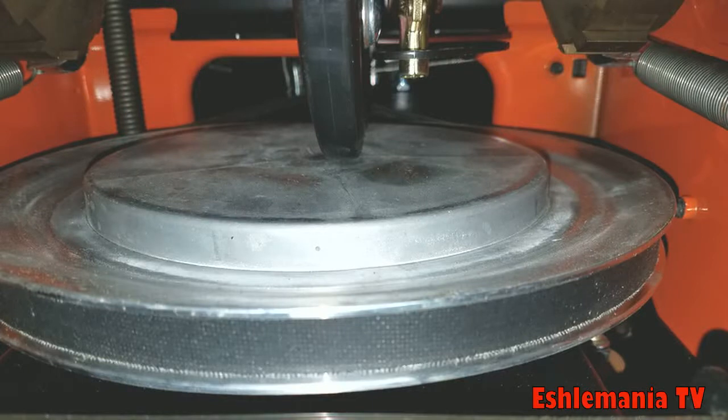This is a look inside the drive housing on the snowblower. You can see the V-belt going around the bottom of the big aluminum pulley there. You can see the rubber friction disc right in the middle of it. When you go to change your speeds or the directions, that friction disc will slide on its shaft either inward or outward on that pulley, and that changes the ratio between the friction disc and that pulley, which increases or lowers your speed and changes the direction. This is basically the parts that make this whole system work underneath inside the housing.